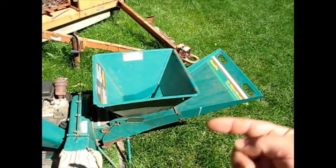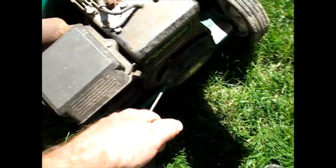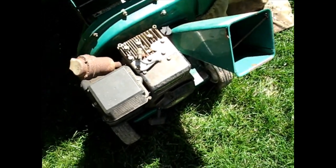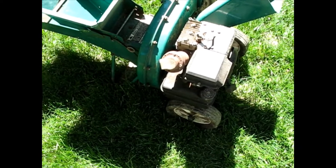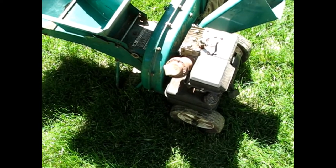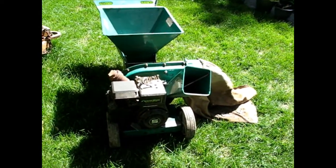Looks like you can move that chute — I think on a lot of these you can drop that chute down to the ground and kind of rake things in there. It's got the bag, which is kind of nice. Looks a little rough but not too bad. The engine doesn't spin, so most likely we've got a rusty cylinder. The rust on the spark plug would suggest it was outside, but it's not that dirty, so maybe inside. We'll see if we can get it to spin over and resurrect this thing into anything usable.